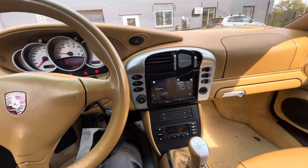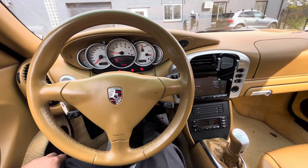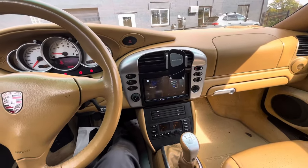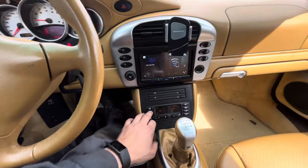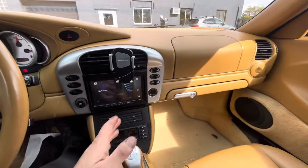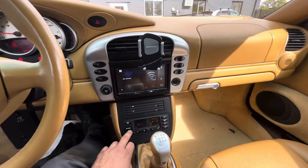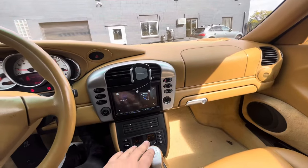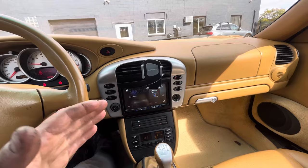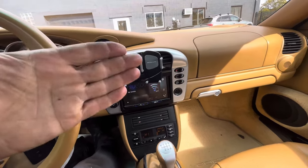I see it very often on early 2000s cars, all the way back to the 90s and even the 80s — kind of the same concept. They used to foam around the climate control flaps: the flaps inside your dashboard that make your defrost work, shut off the air going to the center vent — you can see this stuff blowing out as I'm talking — and the flaps that move the air around. The blend door that controls the temperature is also coated in foam, and that's what seals against the box to divert the air.